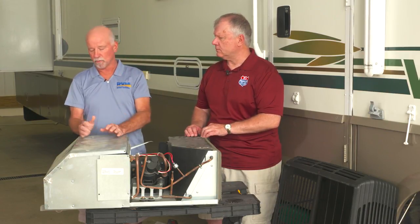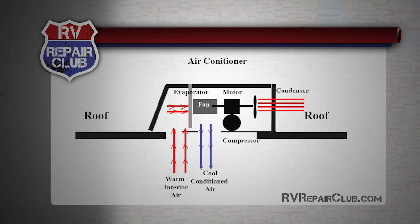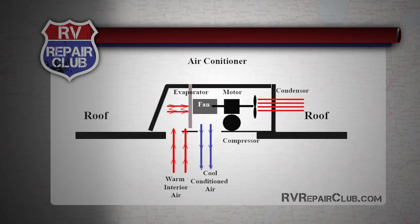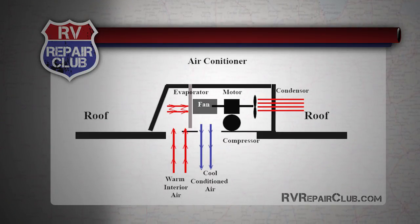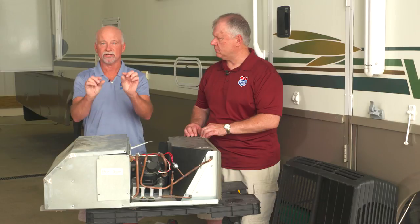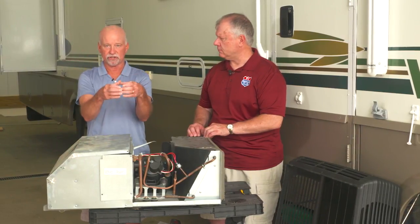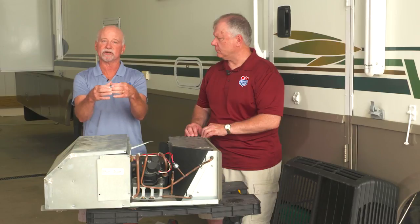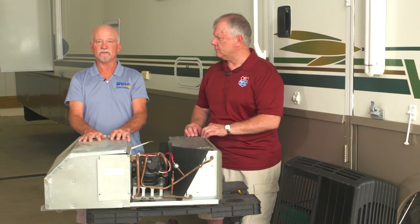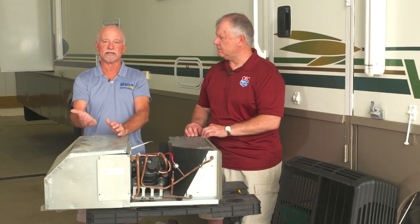If you have all your windows closed and you start out at 96 degrees, the return air is going to pull that 96 degrees in, run it through the evaporator coil, and it might only drop it two degrees while extracting some moisture. That air coming out might go from 96 down to 91 or 90, and it just keeps recirculating. As long as you keep the windows and doors closed and it recirculates, that temperature is going to continually drop. The differential between intake air from the cabin and discharge air from the air conditioner will be about 16 to 22 degrees — that is about the most efficient any of these units will do. But keep in mind, that 16 to 22 degree differential is constantly being lowered: as the return air cools down, so does the discharge air.